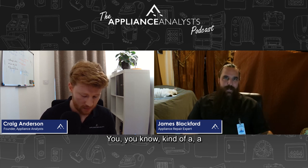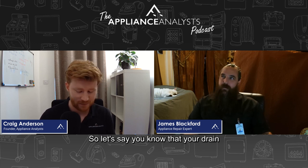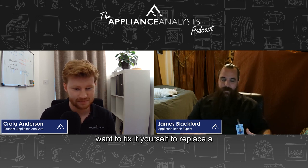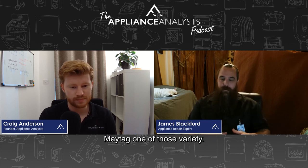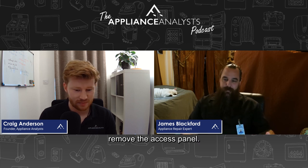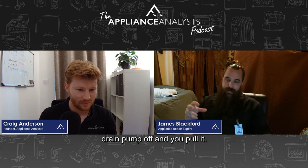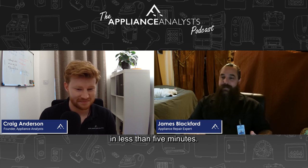Yeah, definitely. You know, a quick anecdotal thing about working on the different brands. Let's say you know that your drain pump is bad. You looked on eBay, it's $25 for a pump, so you want to fix it yourself. To replace a drain pump on a Kenmore, Whirlpool, Maytag, one of those variety, it's literally two screws or two clips to remove the access panel, one wire connection, and then a clip that you press with your finger, you turn the drain pump off, and you pull it. That's the extent of the repair. A technician could do it in less than 5 minutes.